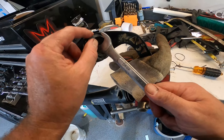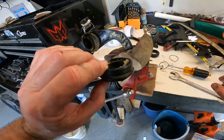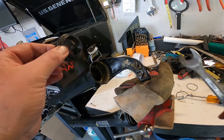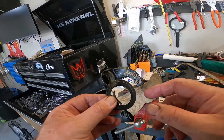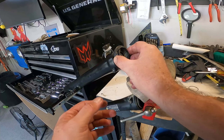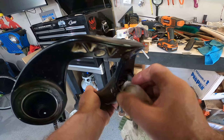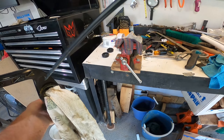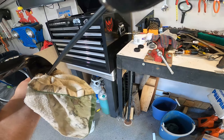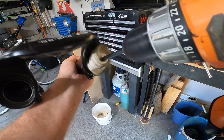I also need to get the spring off of here first. Because I'd never done this before I was a little nervous, so I ended up staying at the very top. But with the replacement seal, you can see it's actually fairly deep — if you're using the wrench you've got to get pretty low to get underneath the harder section. I got underneath the harder part and popped it off. Just get underneath the harder part of the ring and pop it off — it takes a little bit of guts to do it.